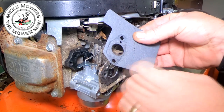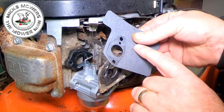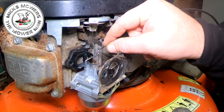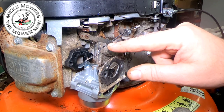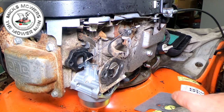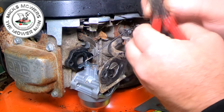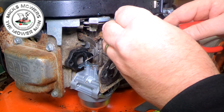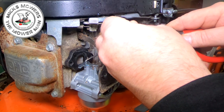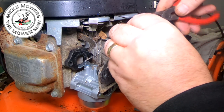But you can see behind here, there's two big kinks in this governor spring. And what I believe was happening is it was getting hooked on this auto choke, getting hooked just in there and it couldn't actually move itself. I don't think that's correct. So what we're going to do is, very simply, grab hold of that little tiny governor spring. I'm just going to work those little tiny kinks out without the spring snapping, of course. Now, sometimes it may pay just to change the actual spring, because sometimes I do lose a bit of tension.